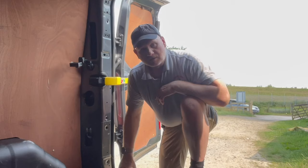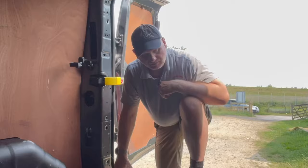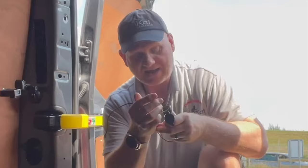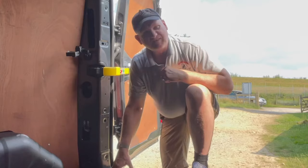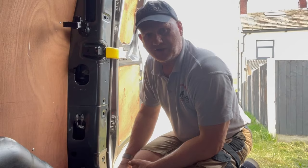Let's get on with it. If you've got this little hole down the bottom here, that is where your secret 12 volt supply is. I've gone onto the internet and bought one of these — a 12 volt power supply, like what the old cigarette lighter went into — and I've put a couple of crimps on the end to be able to plug it into the Ford socket. What I've got to do now is go down here and fish out this orange plug, which I believe is here. Here's the secret socket.